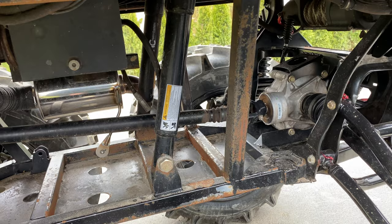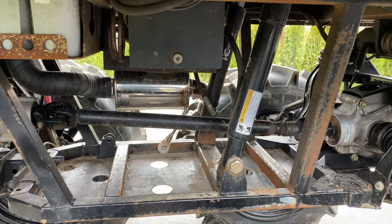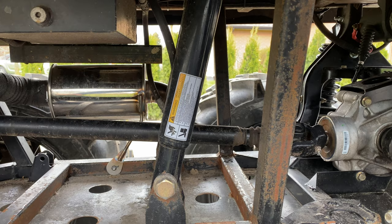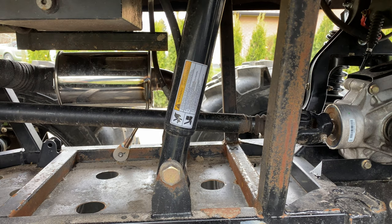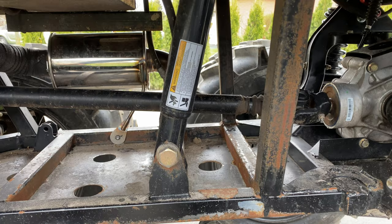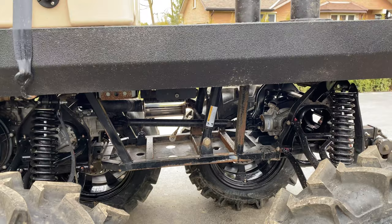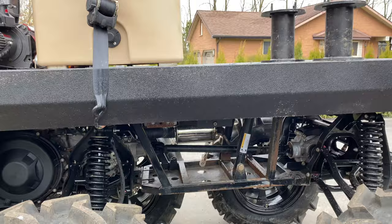The difference is we did have to extend it — we had to cut it just about here, put frame stiffeners in, and get it a little bit longer. We extended the driveshaft as well. I do apologize about the rust — we are learning, so if you're going to do anything like this, absolutely get it powder coated. This is all coming back off, getting sandblasted and powder coated in the very near future. A unique build like this can't have rust on it. I am going to sand it down and hit it with some paint, but this is not a SEMA build — this is purpose built and we are going to abuse it as such.